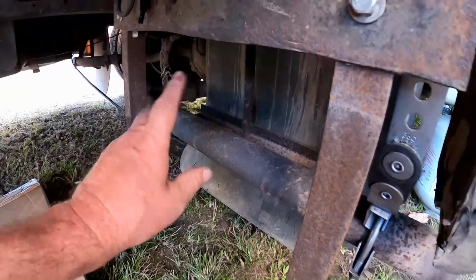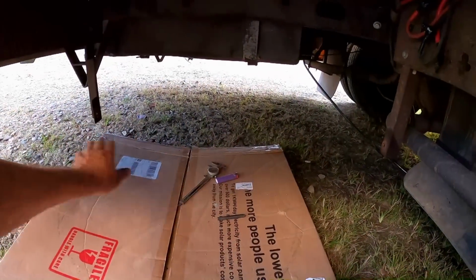I'm gonna do that inner one, and lower these other 3, and then we'll be able to put that generator tray in. Now I remember why I had that wire around this one. The bottom is completely blown out of it. Sometimes these have a way of collecting dirt down inside, and it just makes them rust out faster. So obviously, this one I'm not going to disturb up top. This part of it's good and solid yet. I'm just going to cut it and then put my new hanger up there and just bolt it through here.